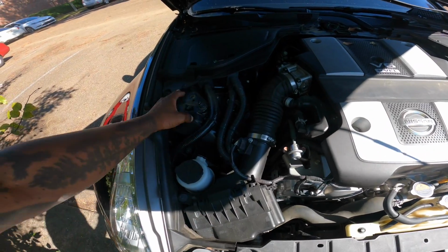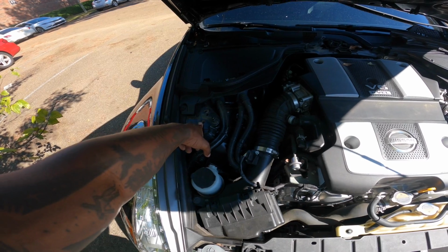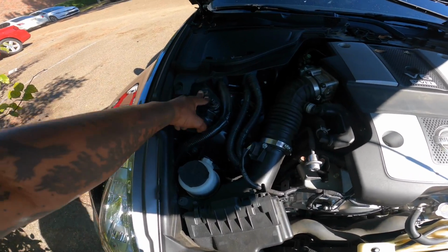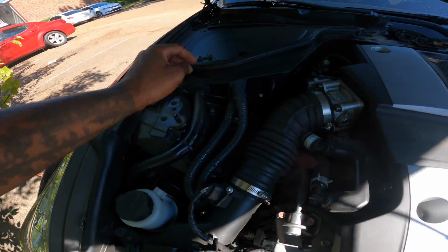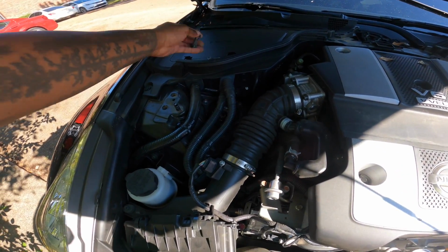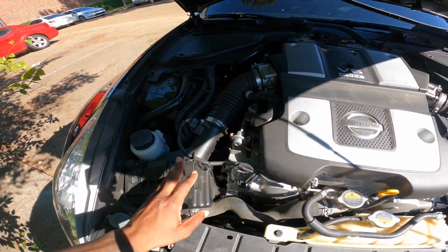And when we took these off, what socket was this? This is the 14? We used the 14 for these and for back there. Be aware that some of them are gonna be screws, some of them just gonna be lugs. We just twist the other lugs back on there so we won't lose them. So we're finna take off these intakes.